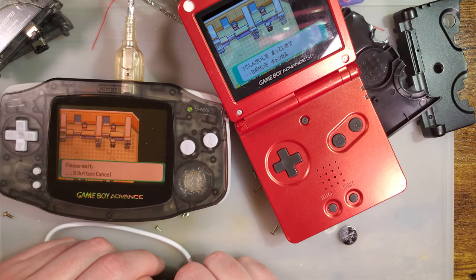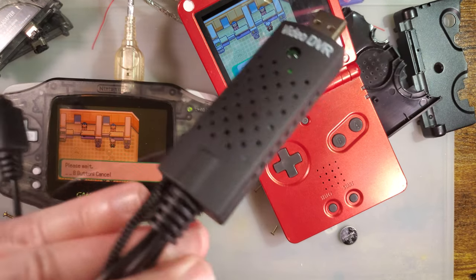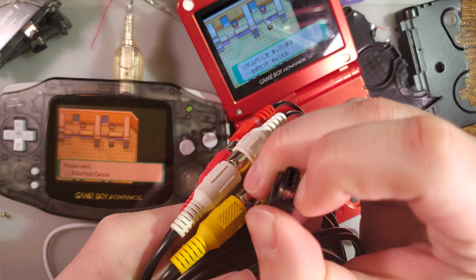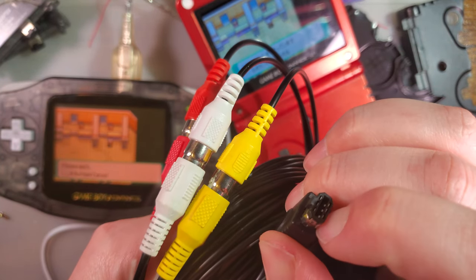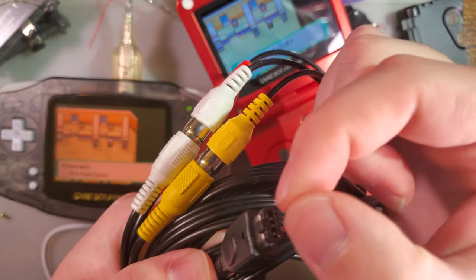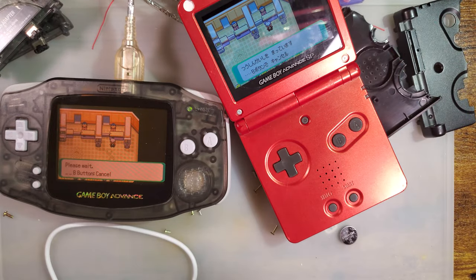Which means your link cable should still work just fine, but your wireless adapter isn't going to work at all — because this relies on the Game Boy Advance for getting power. It is what it is. You can take the cable, pop this housing apart, slip the sleeving off somehow, pull the pin out of whichever socket it's in — pin 3 — and then swap it with pin 1. And that's your workaround.